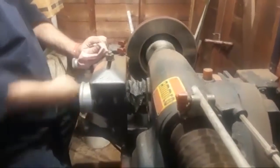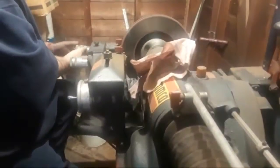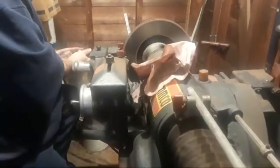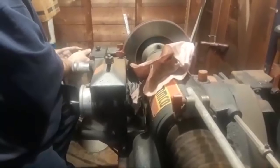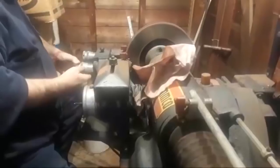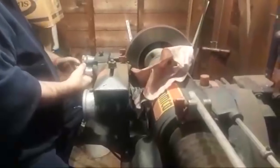When I get about halfway in, I want to take each one of these blades with these loose. I want to take my dial here and zero this out. So I'm going to hold this on 0, the inner sleeve, while I crank down on the outer adjustment. And in a second, I should hear my blade making contact with the brake rotor. When I hear it start to make contact, I want to stop. Right there. Okay, I'm going to do the same thing for this side. Again, I want to zero this out by holding the outer sleeve in place, and then turn the dial in.